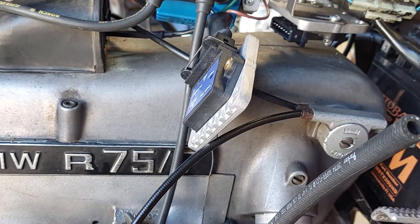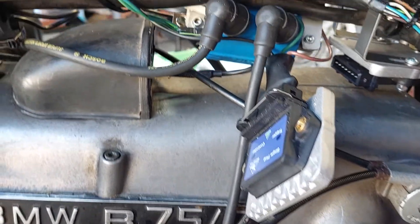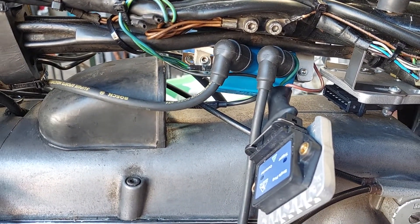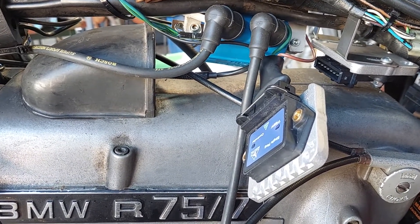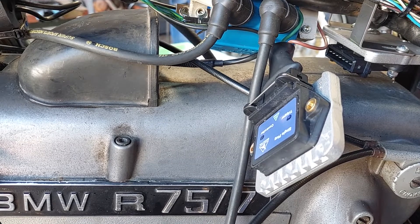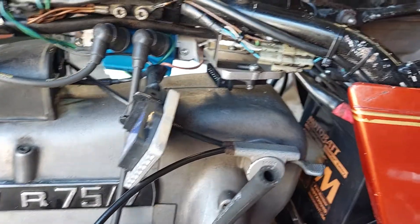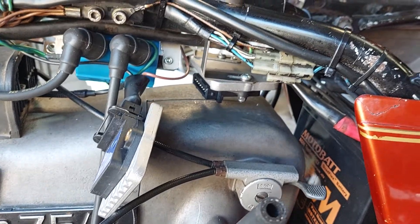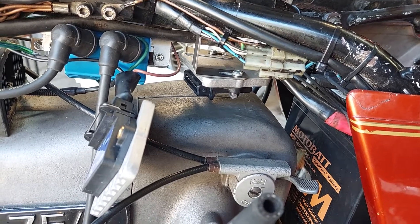So there you go — that's the operation and installation of a Wedge Tail Australia ignition system on a points ignition bike. It's quite a simple and straightforward process. I've gone around and tidied up most of the wiring; I've got a little bit to do under the front cover. I tend to leave the rubber tube and everything off the timing mechanism while doing it because there's a spring in there that can sometimes pull it around while you're trying to tighten everything up. Do remember to take the allen key out of the center bolt on your alternator, and remember to tighten up the points plate when you're finished. If you have two coils it's the same operation. Ride safely, stay well, until we meet again.